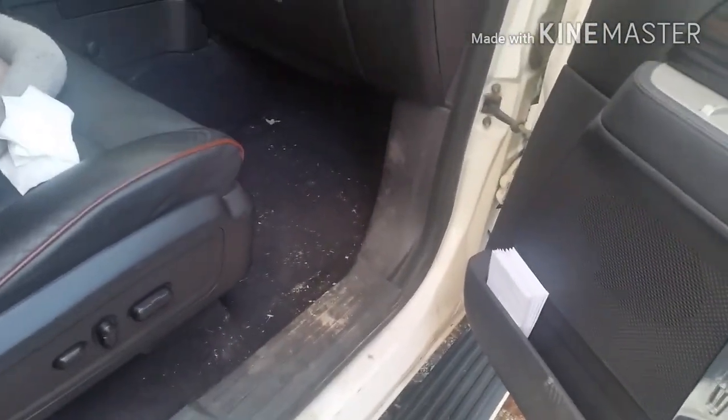What we're going to do is open the passenger side door. Sorry the car's a little dirty right now, I haven't had time to clean it up. Move the wife's shoes here. We'll put that down there in case I have to kneel on it. It's really a simple process on this car. The code is located on a junction box — the SJB box, whatever it's called — right behind this kick panel right here. The first thing we do is pop up this foot panel here like so.